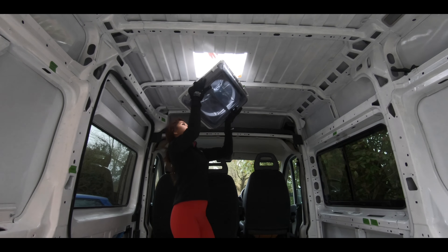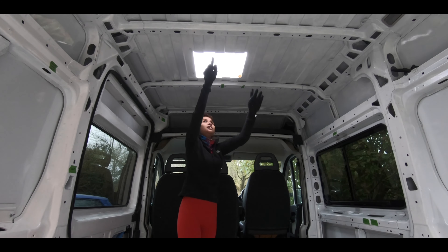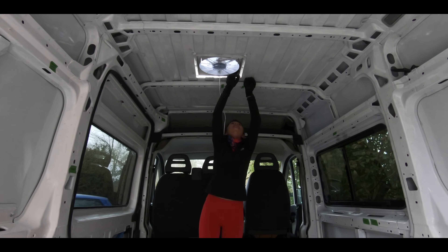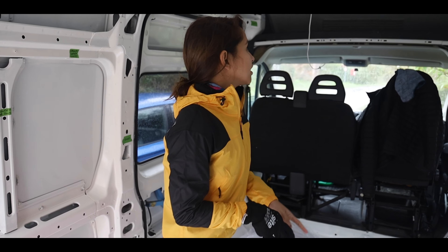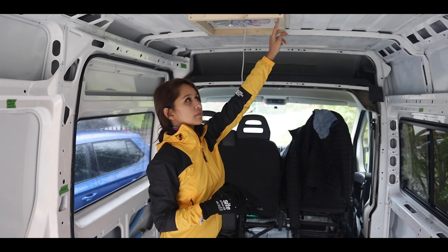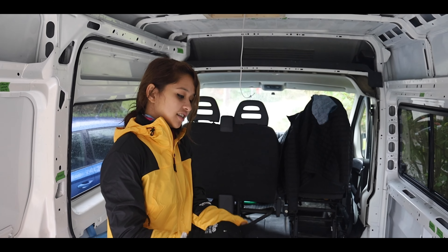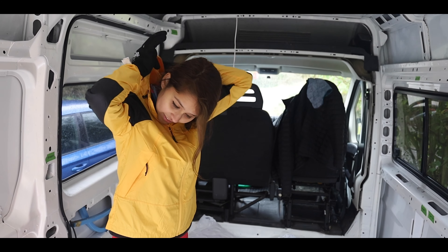Rome is drilling the four corners of our hole so we can re-measure it on top of the van. He looks like an Eskimo because he's partly sick and freezing cold in here — this is why we don't build our van in the winter! Bear in mind these are not our jigsaw starter holes; they are really tiny. We're using a number four drill bit just to mark the four corners on the top side of the van so we know where to measure our square on top.